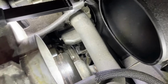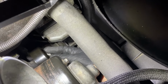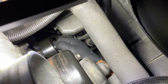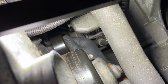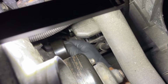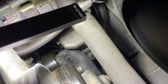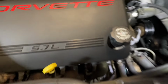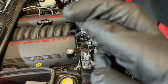Right, so I find if you remove the air bridge, you can get into this pulley a lot easier. You can just reach around this side of your hand and just start turning it by hand at first, just to seat it in place. And you can get around the water pump, no problem. Don't need to remove anything else, but I've removed the air bridge here so you can see it. You could probably do this without removing it, but for all it takes, it just makes life easier. Okay, so let's tighten that up to 37 pounds foot, and then let's put on the belt, and fingers crossed